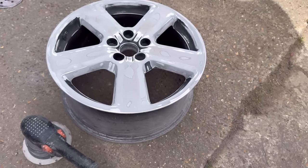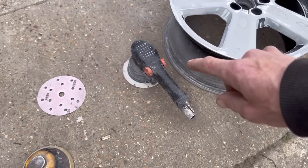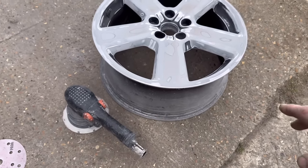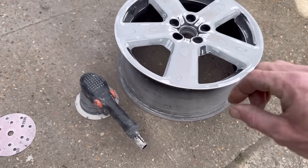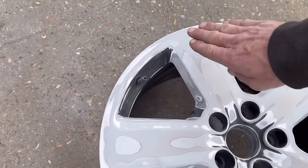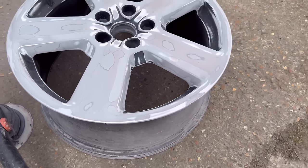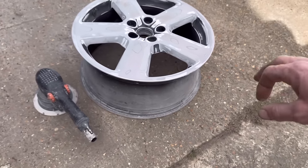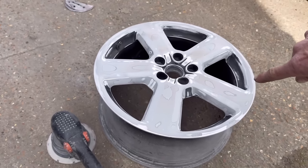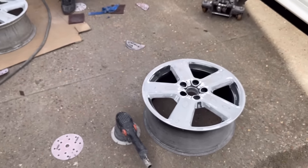It's just normal filler — not special metal filler or anything like that. Normal car body filler works perfect. I've got a panel sander — you can use a normal sander, but I'm on the panel sander, it's a little bit more aggressive. If you've got loads of chips, you might want to start with 80 grit. This has already been smoothed out so I've got 120 on the panel sander. Once I've gone around the flat edge, I'll then run around the top edge — that leaves a sharp line on the corner, and paint doesn't like sticking to sharp lines. So I'll get 180 in my hand, fold it over, run around the edge to take out my 120 marks and round off the lip.